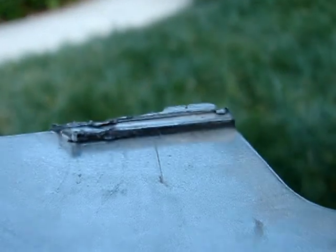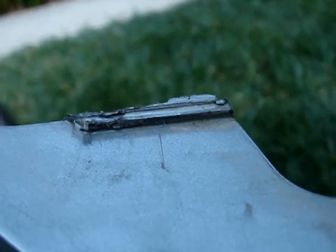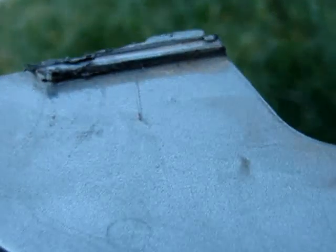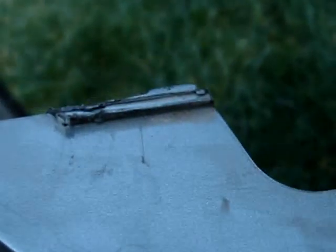Here's the inside. It's the same thing. It's just 2 tabs there. The other tricky one is this one under the light. You see there's a flange? There's like an upturned piece right there on the rear bumper that slides in that slot underneath the tail light. So when you take an instrument, you put it in there and you push down on it to disengage that tab.